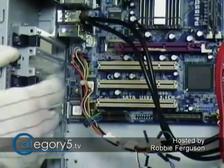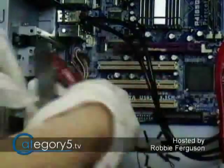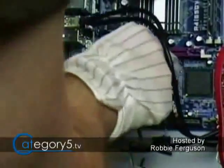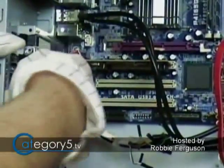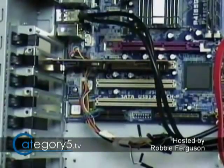In past years, Unraid was pretty hardware specific, so you could have trouble with different cards or different motherboards. But generally speaking, it's become very unspecific as far as what hardware it requires to run. In this case, I've been able to install just a cheap SIS SATA2 controller, which gives me an extra two ports, and it works just fine in Unraid.